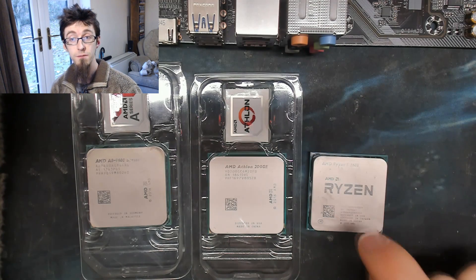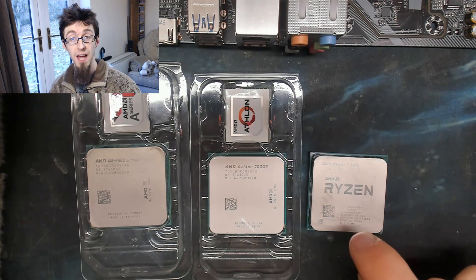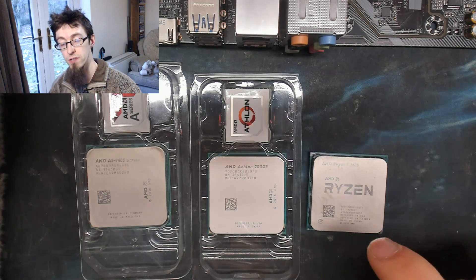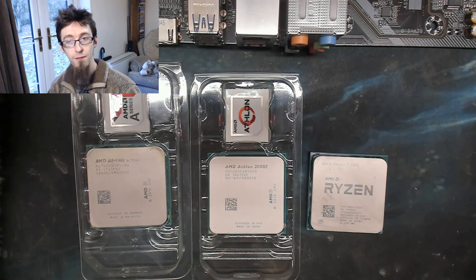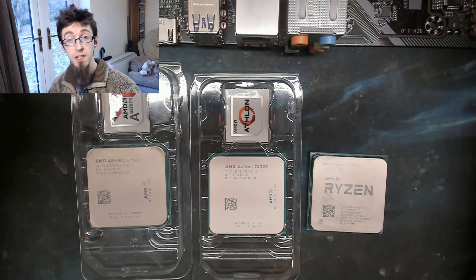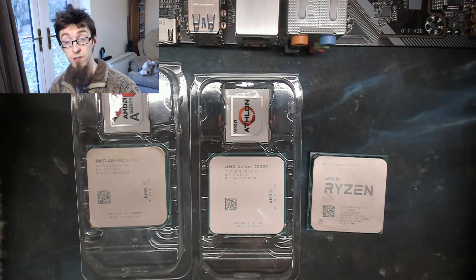This means that lately I've been doing BIOS flashes where my A8 is incompatible after the flash — but this isn't an issue because then I drop in a Ryzen 3000 and I'm fine. However, the B450 Aorus M is different to other boards I've worked with in that it requires sequential updates. If you're running an early BIOS like F1 to F5, you have to update to version F30 or F32 before you can go up to F40 or higher where Ryzen 3000 support comes in.